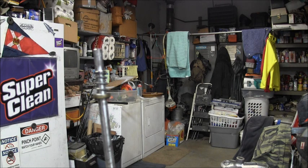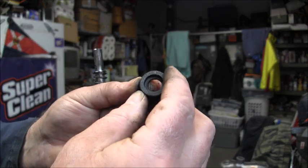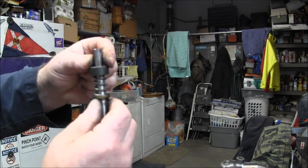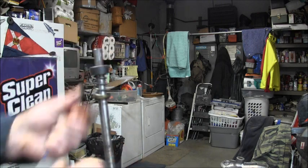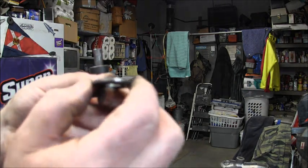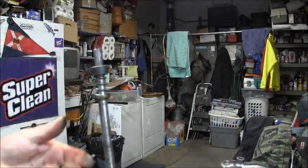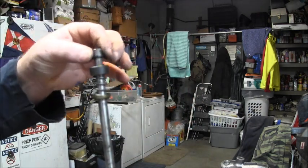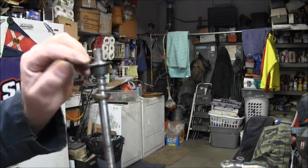Okay. Now, you've got on this carbon ceramic washer a deep side for the spring and a narrower side for the O-ring. So this goes down and the spring. Now the spring, you can see, is going to have pressure when this drive shaft is raised up and stabbed in there. Now here's this washer. You can see it's got a little raised lip there. Whoops, first we got to put the O-ring. Here's the O-ring. It goes down in that carbon ceramic seal, in that little groove there. Then this faces up with that lip up.